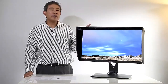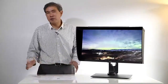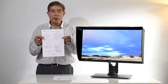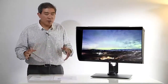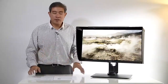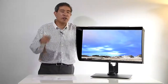One more thing: this panel is IPS — in-plane switching — meaning when you have people gathered around, whether they're in the middle or on the side, they'll be looking at the exact same picture with very little color variation. Also, if you've purchased any hardware calibrated display before, you get a factory report card — a health report from the manufacturer. Normal displays don't come with anything like this. These come with high-end hardware calibrated displays to confirm good color display, good curve and color response, and a great delta E value before it leaves the factory floor. The report always lists the serial number and model number, so it's a custom report for that specific display.